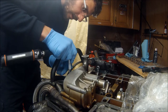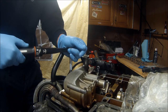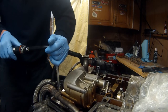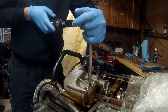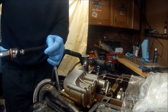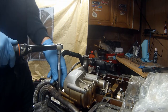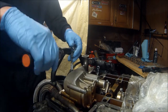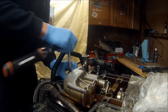Whenever doing something like this I always get the bolts in at a semi-tight stage all the way around, just so it's all the way sat down. So they're all done up to 20 newton metres.